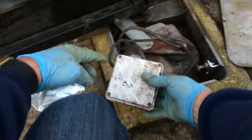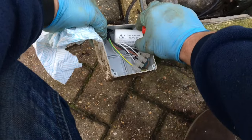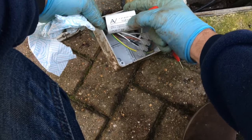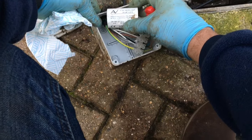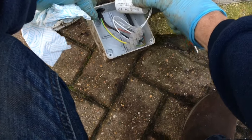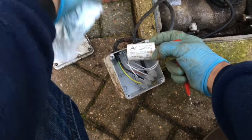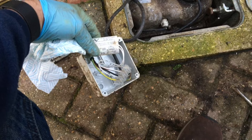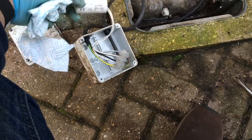There are four screws on the top which are already undone. Inside you'll find a little junction strip terminal and this capacitor, which is a value of 10 microfarads at between 420 and 470 volts depending on the lifetime. Basically, like a lot of electronic systems, this capacitor has failed — probably gone to quite a low capacitance value. I measured it; it hasn't shorted out, so that's the only other way it can fail.